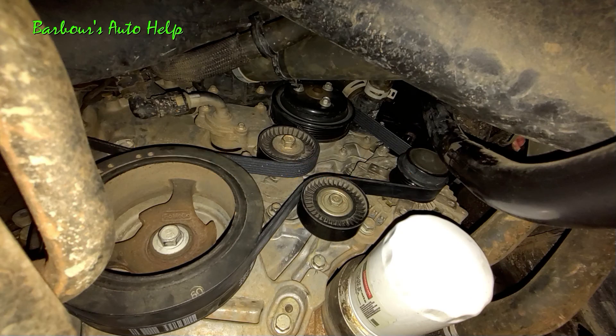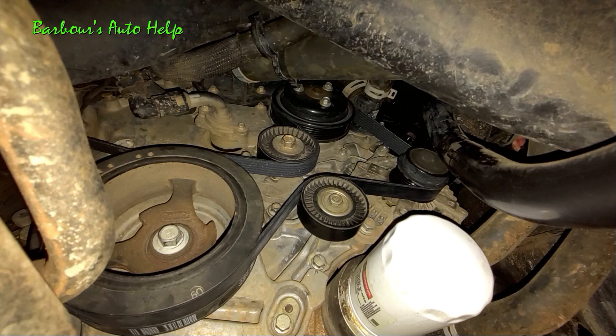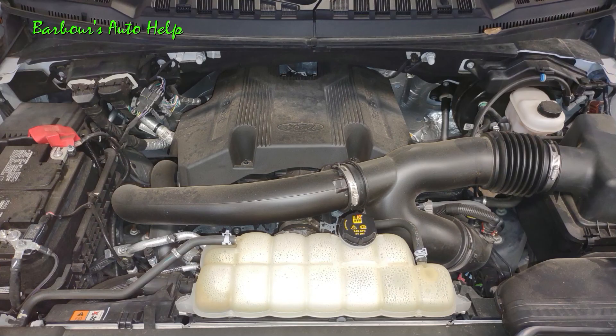Make sure you get your tools out of there and double check all your pulleys — make sure the belt is routed in the grooves of all the pulleys all the way around, and also check your AC belt in the same manner. Once you've checked all that, go ahead and lower the vehicle, reattach your negative battery cable, and start it. Let it run for a couple of seconds, then get back underneath with the engine off and double check everything to make sure it's still routed correctly. Then reinstall your splash shield or whatever you had to remove to gain access, put all that back together, and you're done.